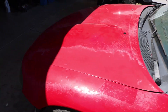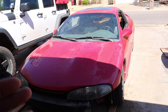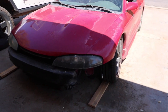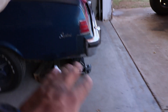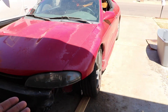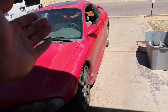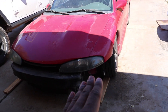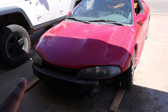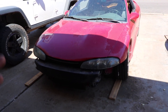Instead, I'm going to open up the engine bay and drain all the fluids and pretty much get it ready so that next weekend I can just get the crane out and pull the 420A. Quick lesson on lowered cars: you need planks to get it up high enough to slide in the jack. This thing is so low and it's unibody, so I can't just jack it up under the footwell or I'll damage the body. I'm going to roll it up on these planks — hopefully that's enough, if not I'll stack another plank on top.